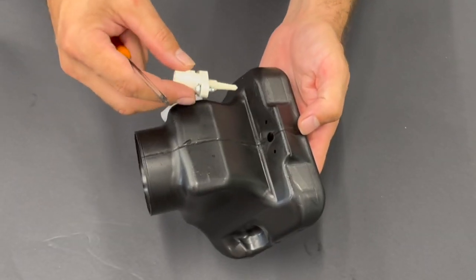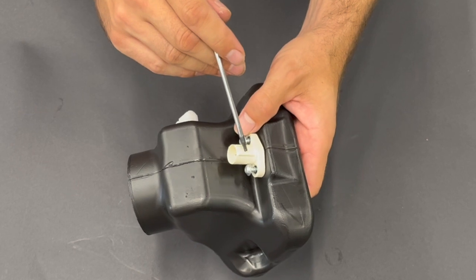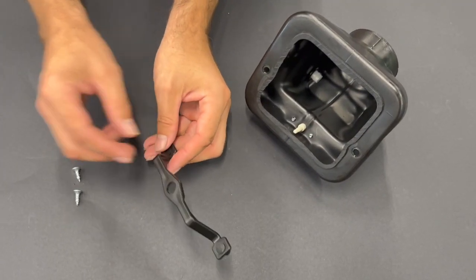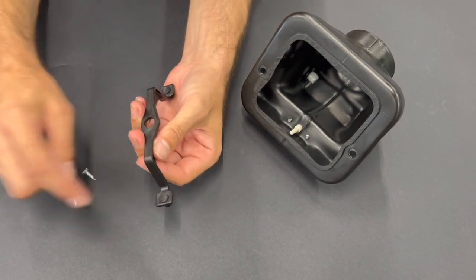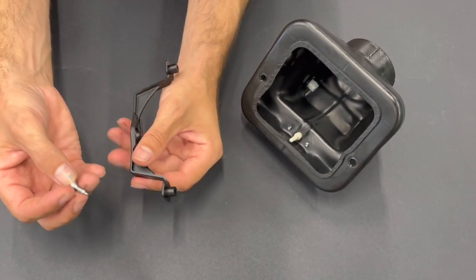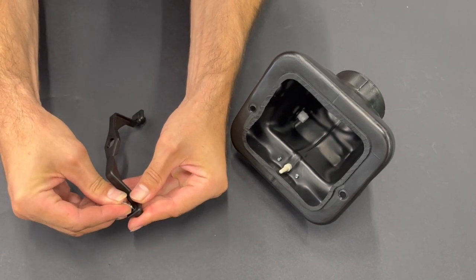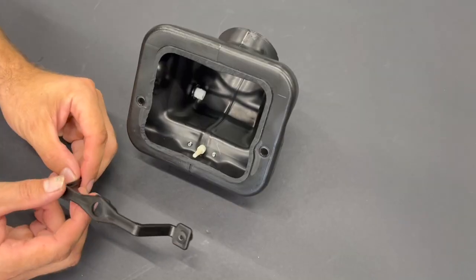Take the small airbox and put the sensor inside. Make sure that the pin is outside and screw it in. Now prepare the arm and the two self-tapping screws. It looks from the top like there is no hole, but that's not true — when you look from the bottom there is a hole for the screws. Here is a small mark, so to make screwing easier, press it lightly to make the mark a little bigger on both sides. Now you have the arm positioned.